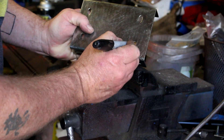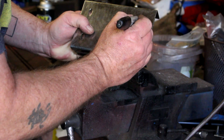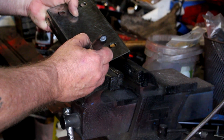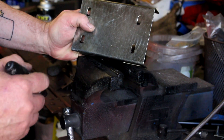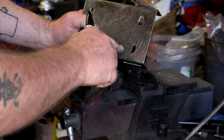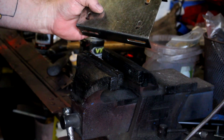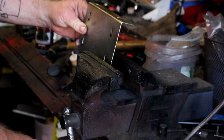I need to grind a little bit of metal off here — marking about an eighth of an inch here. This is going to be the front of the bike. I need to move the motor in a little bit; I've just found that to be the case in most installations. What I do with this particular one is take a drill bit and ream the hole, bringing it back and forth to take a little bit of metal off — just a little bit is all I need. Then I install the motor pushed in, so I've got plenty of adjustment and won't have to take it off and grind it again. Most of the time I have to take advantage of that little bit of extra space.